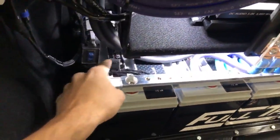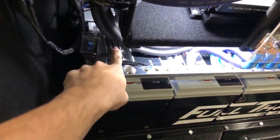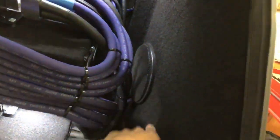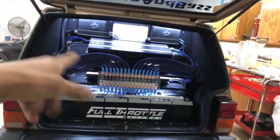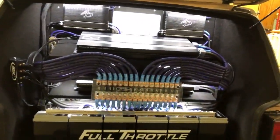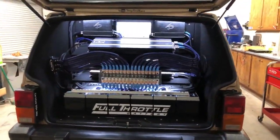For accessories: I wired my head unit to the back battery bank to help eliminate engine noise — this is the fuse for that — and this is the fuse for the switch which controls my fans. The fans pull air from outside and push it in through this vent, which is a speaker grill, and then one pulls air out to the outside. I wanted to locate them higher since heat rises but I was unable to due to the limitations behind the trim panels. It still works pretty well and definitely brings the temperature down a lot, since when I'm driving with the thing shut there's no other ventilation.